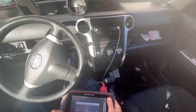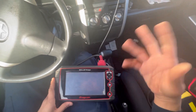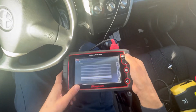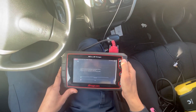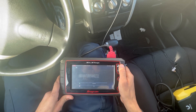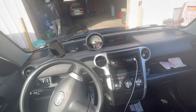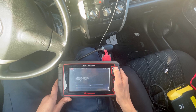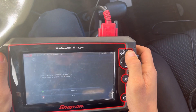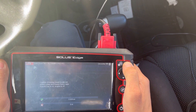What I'm going to do now is put this in check mode. The car will test all the functions of the vehicle. This function, when directed by the shop manual, allows two-trip DTCs to be set in one trip — it tightens the DTC detection so codes will set easier. Let's enable check mode. With no existing codes, it's currently in check mode.